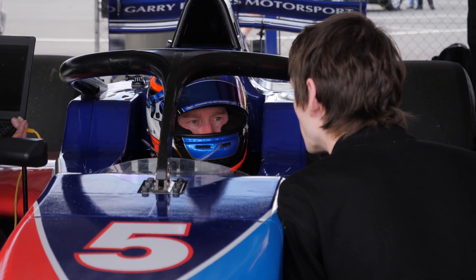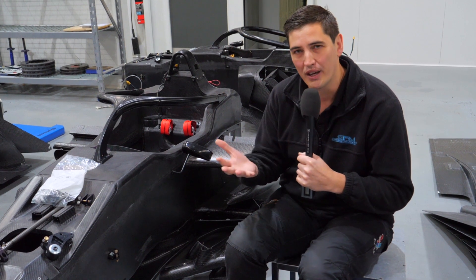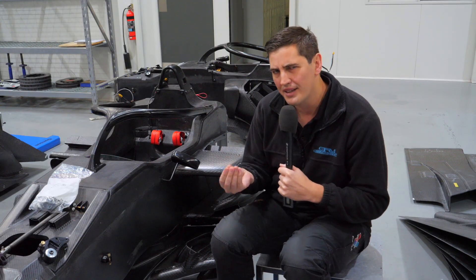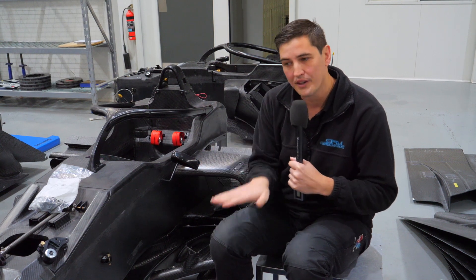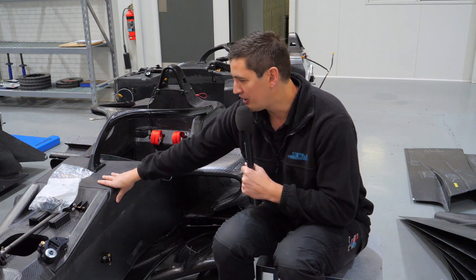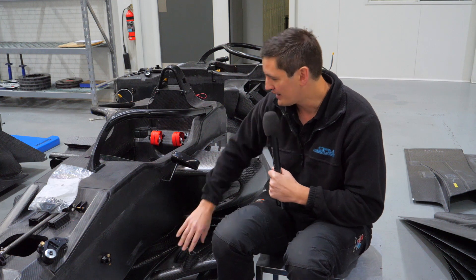With carbon monocoques, if you have a look at these up close, you can see there's a composite weave in there. The orientation of these fibres is actually very important to how this will deal with stresses from the inputs and from crashes. With the thickness of the layers, there's quite a lot of sheets in there, and you can't just go laying them up wherever you feel like — you actually have to orientate them. There's a process they go through to ensure that the rigidity of the structure is as sound as can possibly be, and if there's an impact, it'll take it.